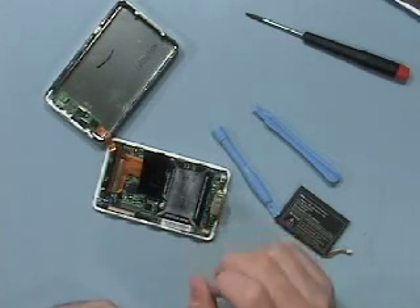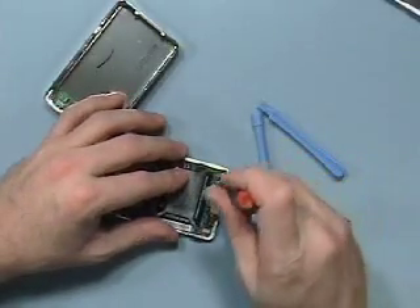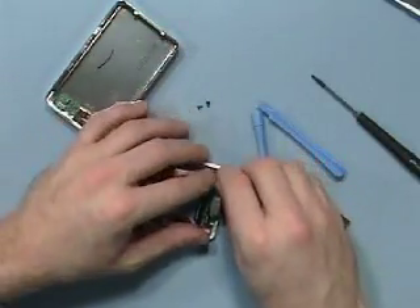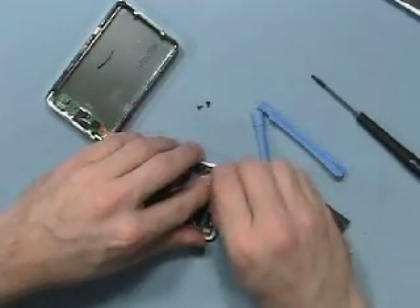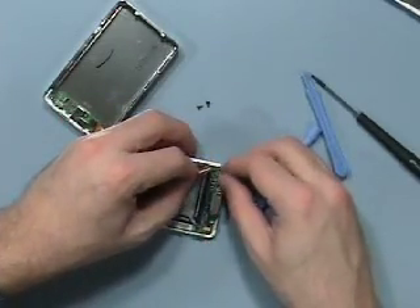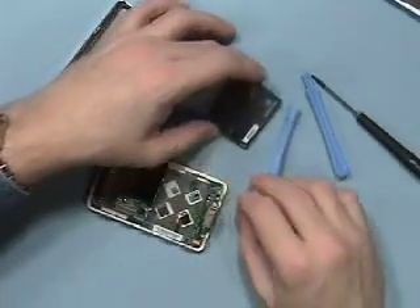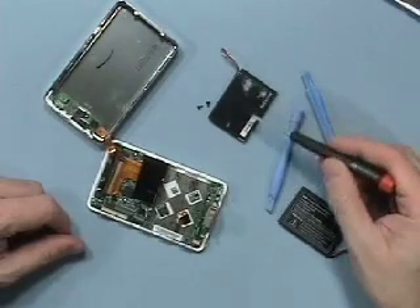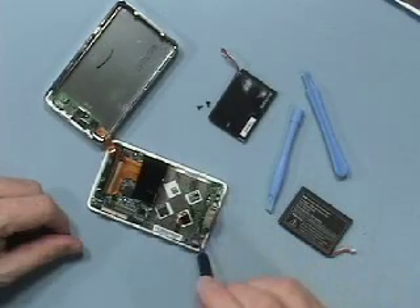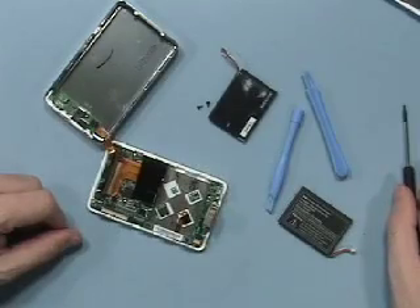Do not damage the iPod doing this — be very careful and use a small amount of heat each time. You'll need to remove the two Torx T6 screws at the bottom of the logic board to allow you to lift up on it to remove the wire. Place your finger over the logic board and gently lift up on the connector. Work the wire out and around the logic board — this is where it can get tough trying to get that adhesive to release. The adhesive was stuck on this battery, and the entire area around the edge of the battery is essentially an adhesive gasket, and popping it loose can be very, very difficult.